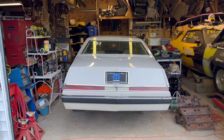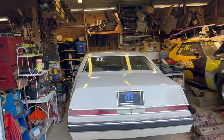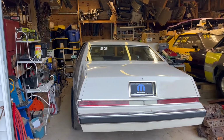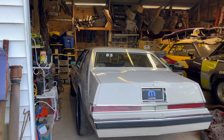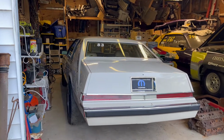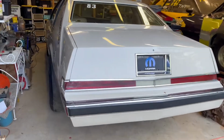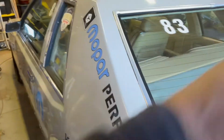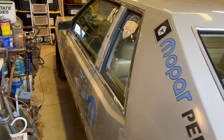I'm not the one that installed that stuff, so I just do not know. I do know all the bolts were loose. Maybe it sprung itself while the bolts were loose. I got the bolts tight now. I have to loosen them back up and drop the shock absorbers, let the axle dangle. But that's another thing. The axle's not in correctly either. This side here is forward three-quarters of an inch to that side, so it's dog walking as it goes. We got to fix all that before I can get to the track, guys.